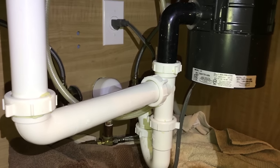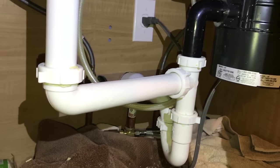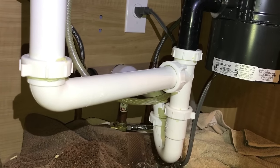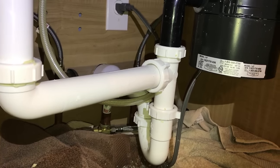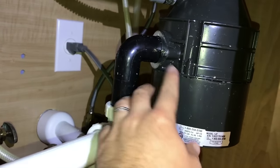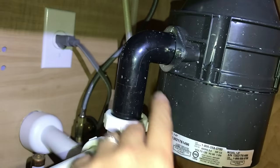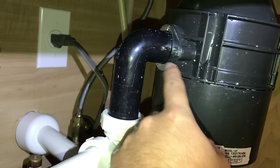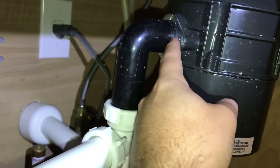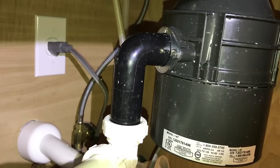Everything has been reassembled — I just reversed the order from what I did before. One note: a lot of this stuff is just hand-tighten only. I really didn't need the vice grips to loosen any of these, so use your hands and hand-tighten as well. Do not over-tighten — this is plastic, and over-tightening can definitely cause issues and cause leaks. I've plugged the garbage disposal back in. When attaching the pipe connection, I installed the left screw first but left it a little loose so I could guide the pipe back onto the disposal and see through the gap to make sure it was aligned properly. I then installed the right screw, tightened it into place, and retightened the left side.